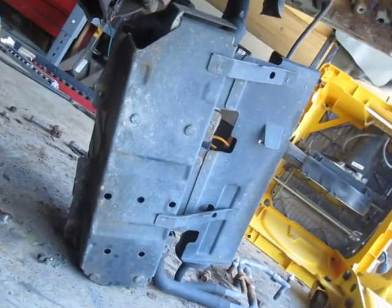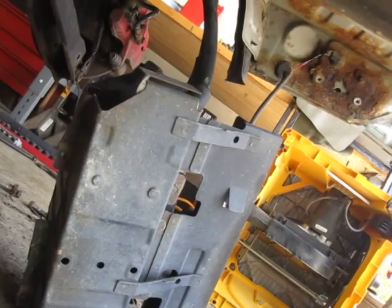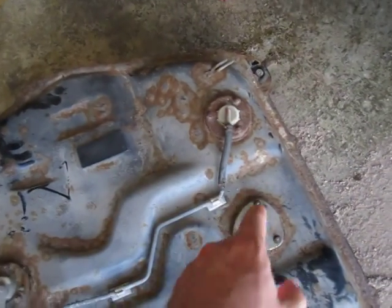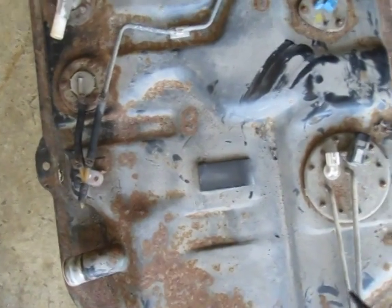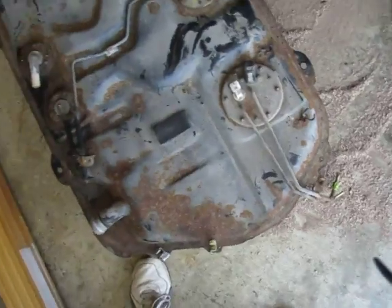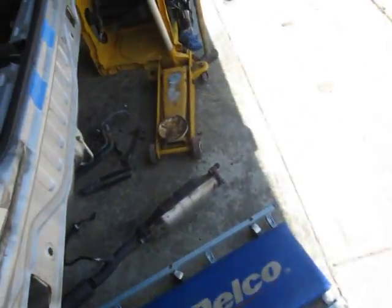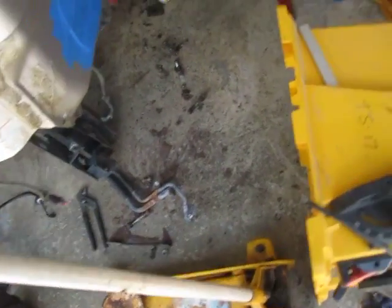I still have to figure out what I'm going to do about the EVAP system — that's a really heavy part of the car. On the older EVO 4 or EVO 5 fuel tank that I have, none of the vents are there like they are on the Mirage tank. I only have one vent, but there are two on the Mirage tank, and I don't have this vent at all on the EVO tank. I've got the older 97 Mirage slash EVO 4/5/6 EVAP canister and I may just switch to this, or I may just remove it entirely because we don't have emissions testing here. That would eliminate a lot of weight, and this isn't exactly a street car at this point.